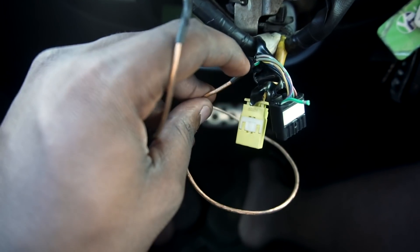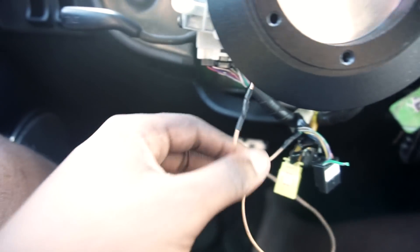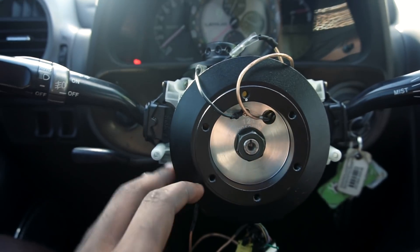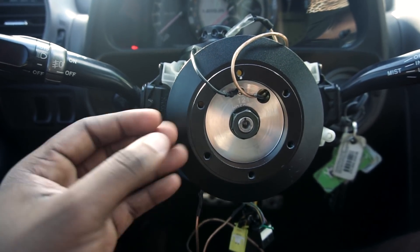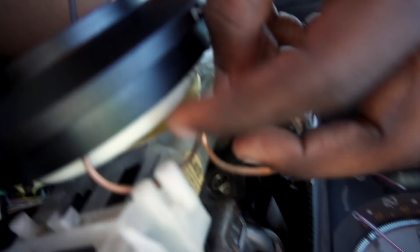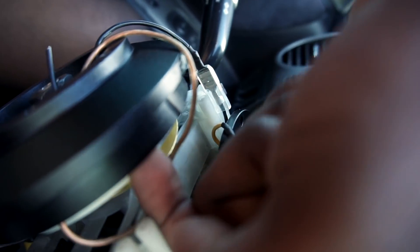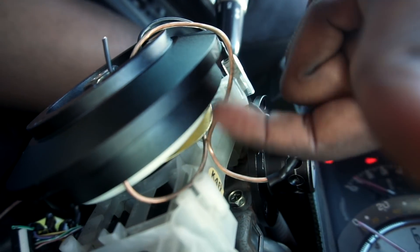So you're going to wire this side of the green wire to the extra wire you have. Make sure you have at least a foot of wire because this is going to be turning — that's where I messed up before, the wire was too short and that's what pulled the piece off the back. After you wire up the green wire, come all the way up to the hub and feed the wire through the opening right there — that's the white ring area where the gold piece is. There's an opening above it, you can even stick your finger through.